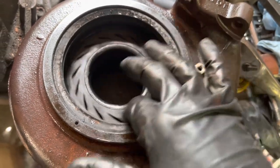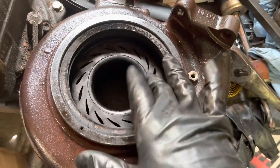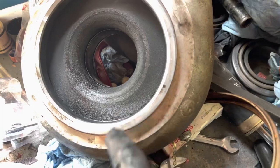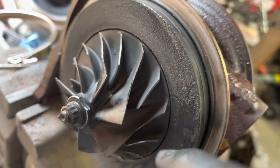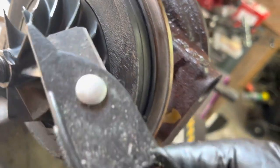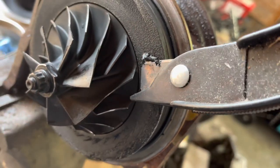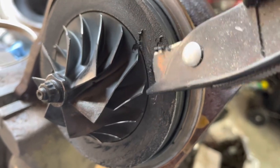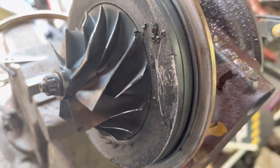There's a locator for these things so when the turbo's spooling it can find its home. When this slides easier that's good. Look at all this oil in there - it's years of buildup. We get a little scraper and look at that - all that is gunk built up over the quarter million miles. That's what we think happened with the VGT slide.